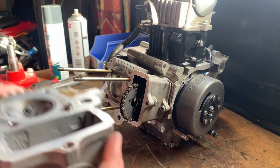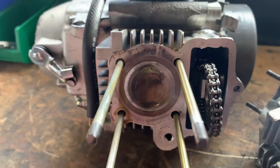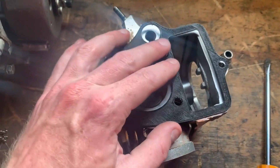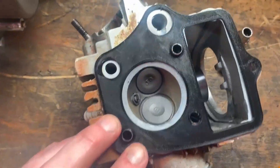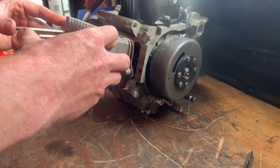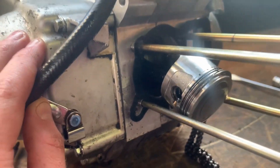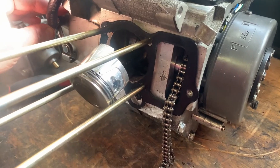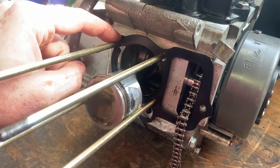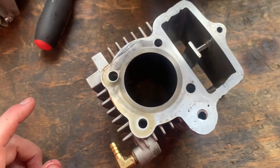What I think is happening is that the squishy base gasket, when it gets hot, causes the head gaskets to lose their tension, thereby letting combustion gases leak out. Shortly after testing the fit, I found out the people I use for laser cutting can't cut copper. So the plan changed: I'm going to stick with the spacer plate for a base gasket so I can run a thin paper gasket on either side. For the head gasket, I've sourced a Viton o-ring. When it shows up, I'm going to machine an o-ring groove into the head, look at the calculations required to make the groove the correct size, and fingers crossed that solves it.